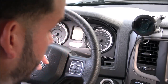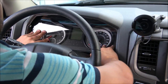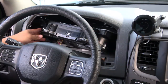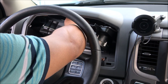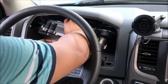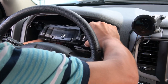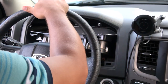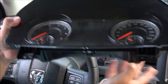There's only one connection on the back side of the cluster itself, so it should be very easy. The best way to get this thing out is by lifting it from the bottom side. Right behind the cluster we have the connector — make sure you push in the pin, which is more towards the upper side. There we go, the cluster is disconnected. I'd recommend bringing the steering wheel down at this point to make it a little bit easier — and voila.